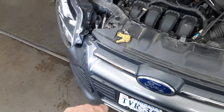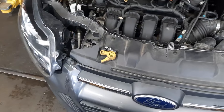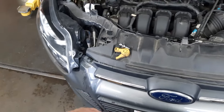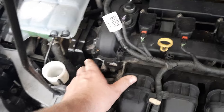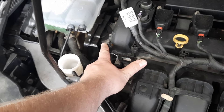To replace it, get a jack with a piece of wood on it, roll it underneath, and jack up the engine a little bit with the wood in between the jack and the oil pan on the engine. Raise it until you see the mount lift off a little bit — you'll see the rubber raise up a little bit.